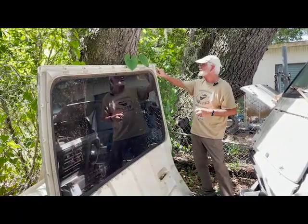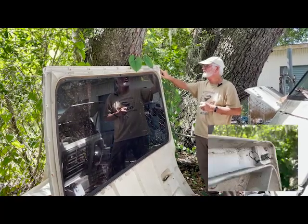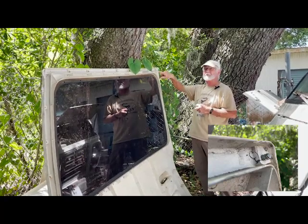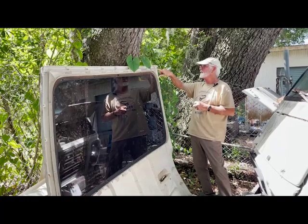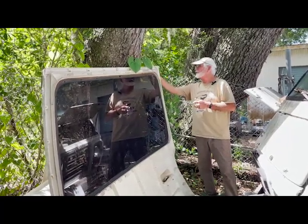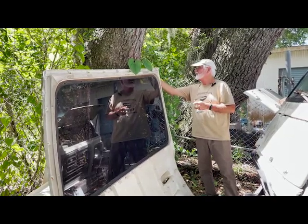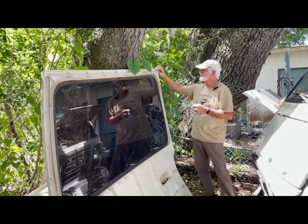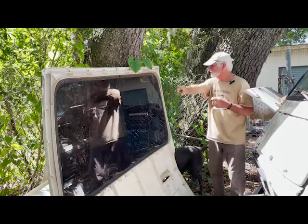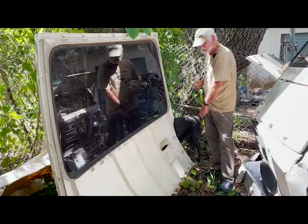I'm going to put a picture up. Shows you the purchase of this screw into the body. You see it? Right. So you can see how far the screw goes in. Now, it's also threaded into the plastic. Okay? It threads into the plastic, too. But where it wants to get purchase is what sticks through, and that picture tells you everything. So that's what's holding this door on. There's 25 screws around here. There's 7 sheet metal screws across the bottom.